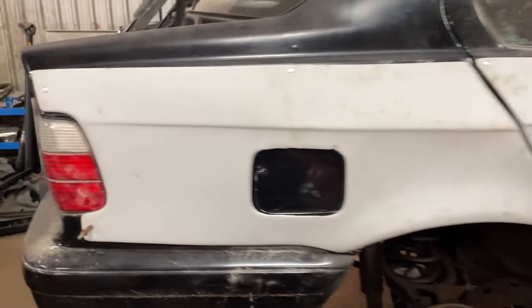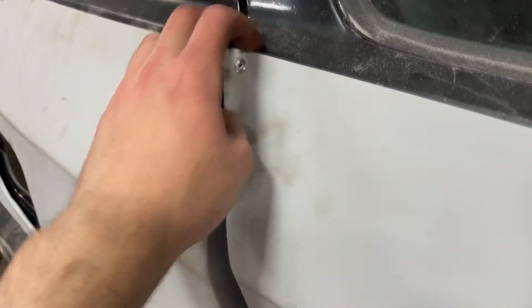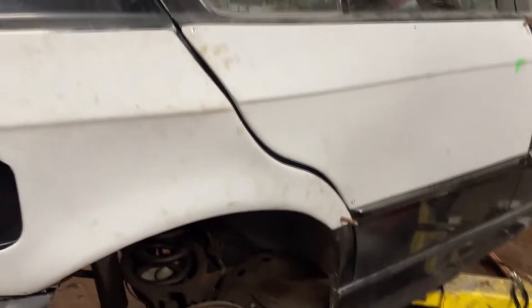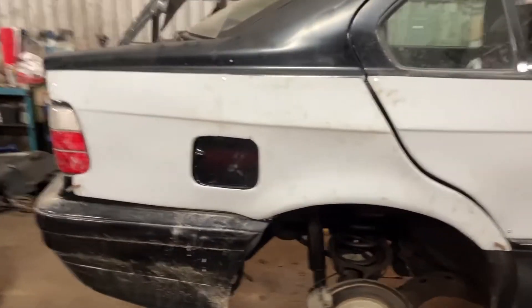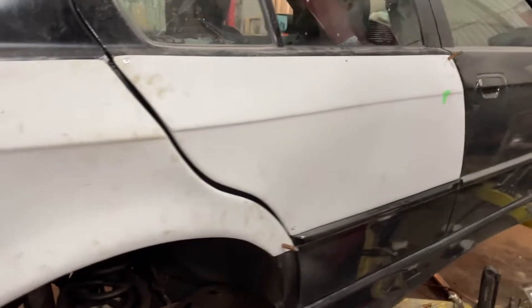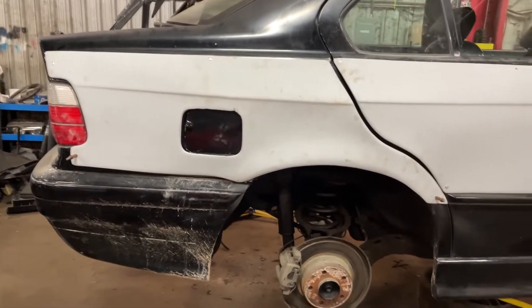Here is the closest I could get this to fit — still not perfect, the body line is a little off and it's not getting any better than this. I put spacers here and there, messed around as much as I could, trimmed the inner skin and trimmed down below. Just garbage molding for these overs — it was cheap so you can't complain too much. The fronts were bad too but I managed to get them to fit alright; the rears are just way off even after all the modification.